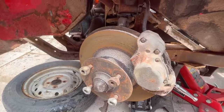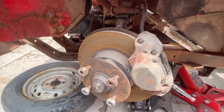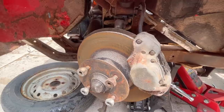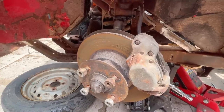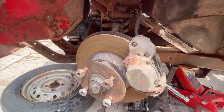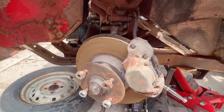But I'm not going to show you step-by-step on this. Maybe I'll set it up as a time-lapse. There are lots of videos out there, including videos on my channel and Lynn's channel on how to do this. So I suggest you do a search and follow those versus trying to watch me do this on a time-lapse. Anyway, first thing we're going to do is pull off the calipers and get rid of the soft brake lines. And then we'll go on from there. We'll remove the rotor and hub assembly and go on from there.